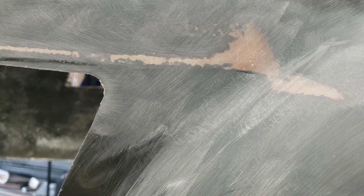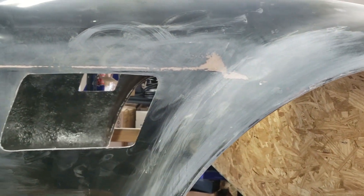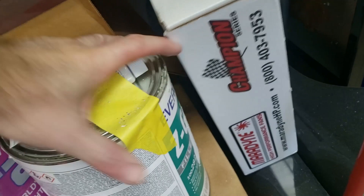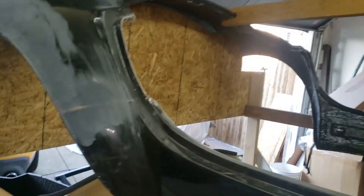Right here is where the seam came in, and you can see this discoloration — that might scare some people because you can actually see through it. But that's not a problem because all it's knocked down is the black gel coat — it still has thick fiberglass on it. What I'm going to do is sand all this down and skim it with Z-Grip from Evercoat, and then I'll work that out. Once I do all of that I'll be shooting some primer.